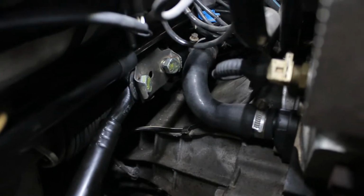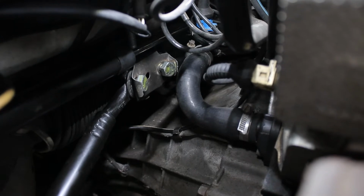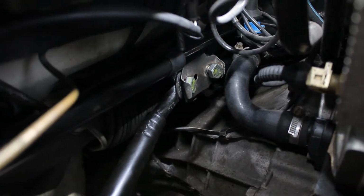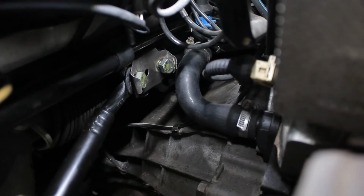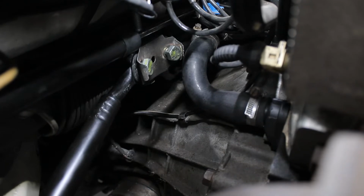Yep. Good news, as you can see from the little battle scar on my face, I finally got in that steering, and both the bolts are right there in front of you. Basically, what ended up transpiring is they bolt through that front plate into that tie rod and then into the rack behind it. So there's basically four things you have to line up, from the front of that plate to the tie rod to the back of the plate to the actual bolt where the hole goes, where the thing goes into.